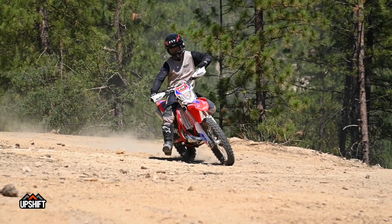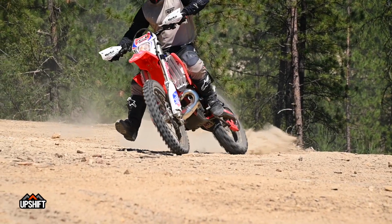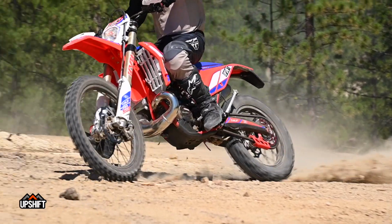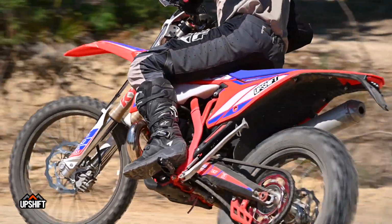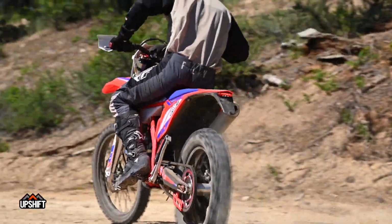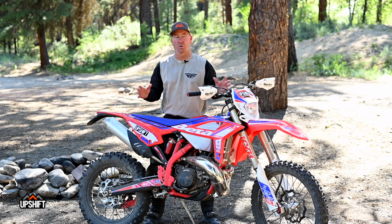So there might only be 50 cc's difference between a 250 and a 300. And yeah, the motors feel drastically different the way they ride. And what's weird is there's really no weight difference between the two, but a 300 feels a little heavier, a little more sluggish side to side than a 250, and that's just basic engine inertia inside, and that can change the whole feel of the bike and the way it handles.